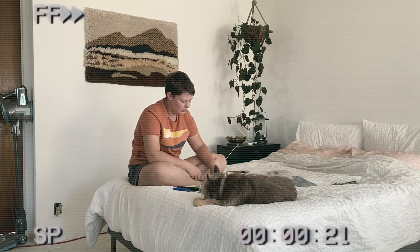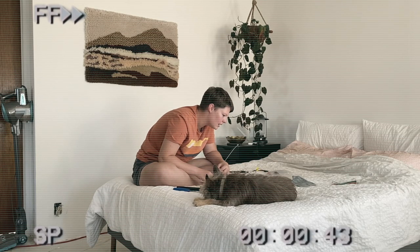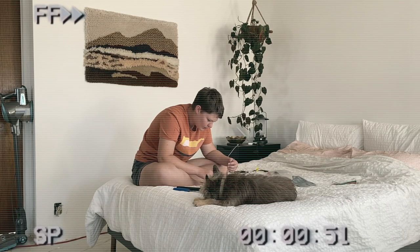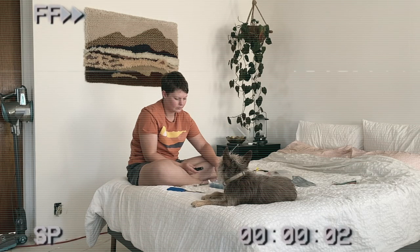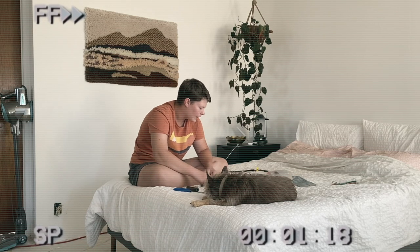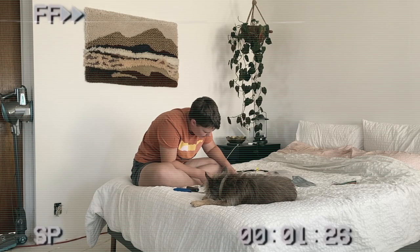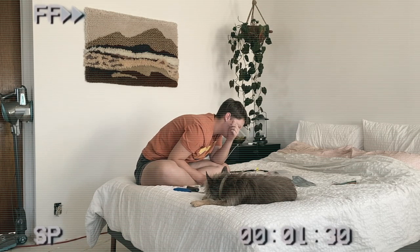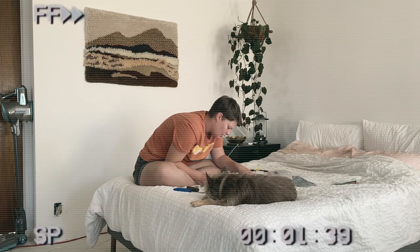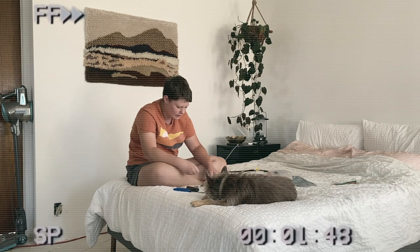So they're just gonna get a little overlappy. Positive is gonna be plain, and negative is gonna be striped, which is correct for either one. Okay, that's all the purples. White and blacks are the left front, positive and negative. And the whites on this are 5 and 6. So we are on left front. 5 and 6 is left front. Okay, so the whites are the same.